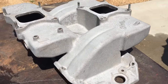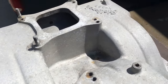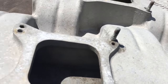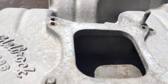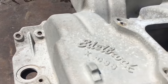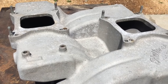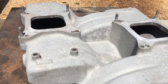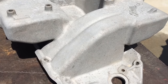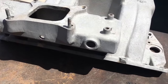Now that it's dry, this is what we're left with. It's just oxidized aluminum, just like most of these intake manifolds turn into — this white oxidation. The only way I know of to get an even finish back on this thing is to either media blast it or paint it. Media blasting is good, but it leaves it a bit more of a dull white or lighter aluminum color than I prefer. The paint I use goes a little bit darker than raw aluminum, but it's a nice even finish.